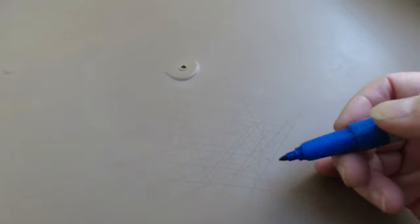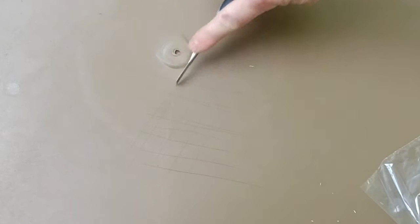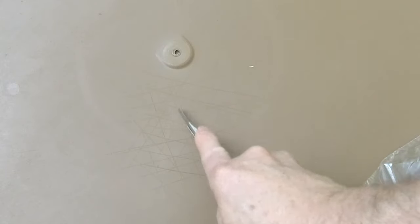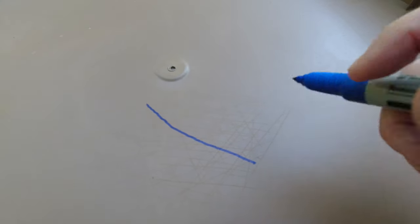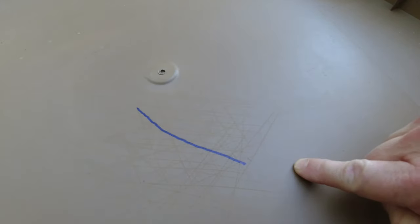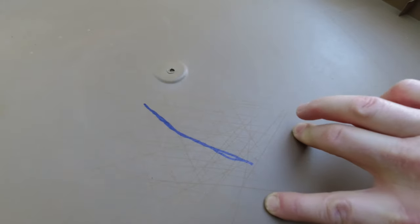This is future self talking about what older self did. This time compared to when I used the other flex products, I went in and did a whole bunch of scoring. I tried sanding it, but see how soft this plastic is? Just some light scoring in here to kind of give a frame for the flex paste to adhere to. Putting that line over the crack was absolutely key because when I did the pasting, that ensured I got an overlap and completely covered the crack. Once you start putting that paste down it's really hard to tell where you're at, and having a line as a target was absolutely essential to patching the area successfully.